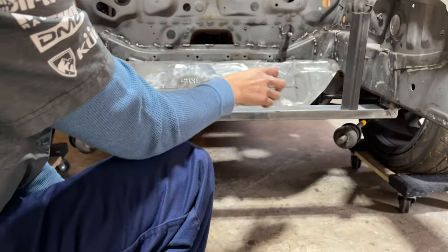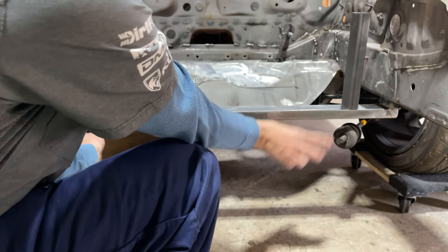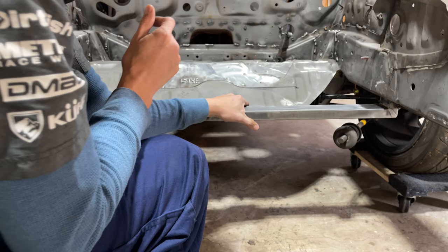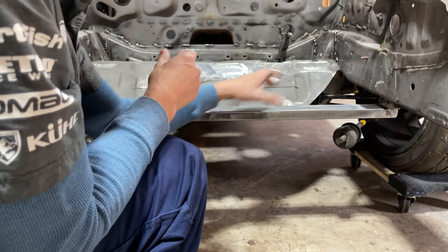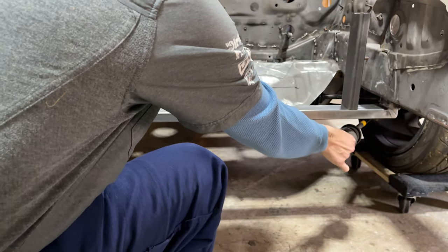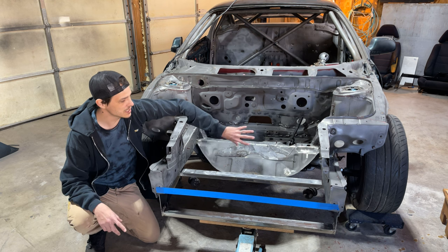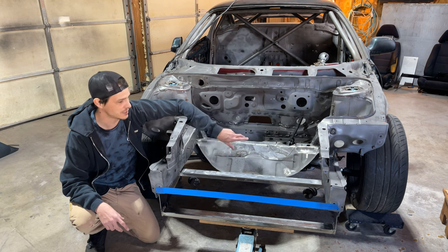We really needed to find some sort of ride height geometry with all this stuff — that's just a fancy way of saying we needed to bolt some stuff on this guy to see where we needed to put the stuff. This is the front sub mount for the torque arms that are part of the front control arms. We wanted to stick with some MR2 stuff, so we went ahead and put this provision back in after it was already cut out of this vehicle. We really did need some of this stuff bolted in to see exactly where to place and what to make.